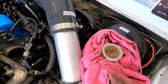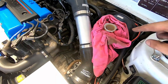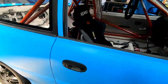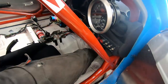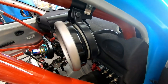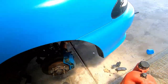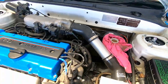Because we pushed the piston back, the reservoir is right at the top now — it was lower before. Once we pump the brake, that'll push the piston back out a bit to seat the pads. After pumping a couple of times the piston has come out to contact the pads, and you can already see the fluid level has dropped about four or five mil.